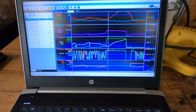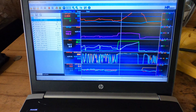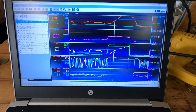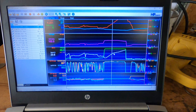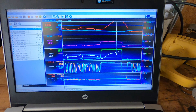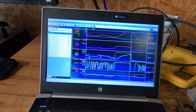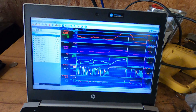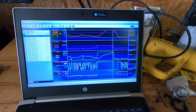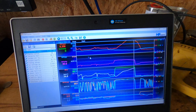Now, ignition timing. If I have a look here: 8 degrees timing down low, then 9 degrees, 13 degrees, 20 degrees, 24, 26, 27, 29, 31 — and the top's out at 34 degrees timing. As hot as the bike got, it was 88 degrees. Our maximum RPM by the looks of it was 8,300, so I didn't even go to 8,500. We might see that magical number if I just go a little bit higher.